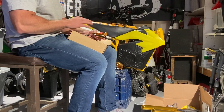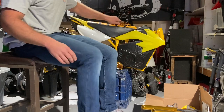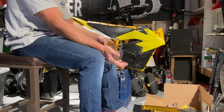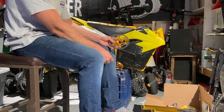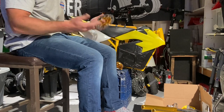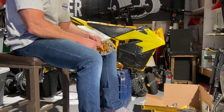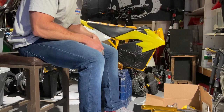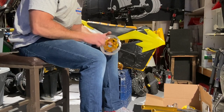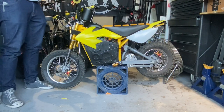I got the gold front and rear hydraulic brakes — those are exciting. I really wish the included discs would fit but the spacing is 44 millimeters and you need 48, so I had to buy the rotors separate. But 30 bucks — big deal. In total, 100 bucks for hydraulic brakes front and rear, which is pretty cheap. I can't use the gold discs but I used the gold bolts to mount them, so at least I got something gold in there.